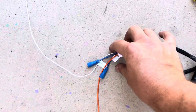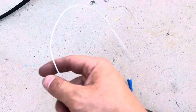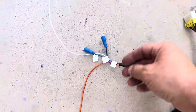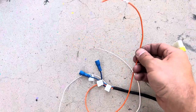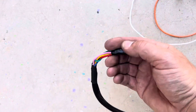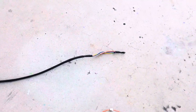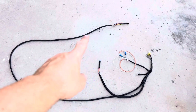This is to tap into my dome light or my reverse lights — I haven't decided what I want those clearance lights to do. This one is for the parking light, so when I turn my lights on it'll illuminate the side marker white. And then this will be for the left. I'm about to pull them through the door grommet. I've taped everything up, it's nylon loomed, and the ends are all heat shrunk. That one runs all the way across. I think it's eight wires on one side and seven wires on the other, and then just a couple that go up into the dash. I've already tested it.